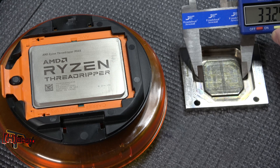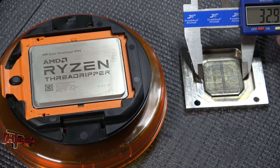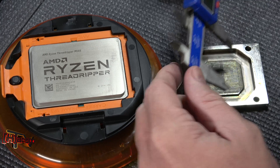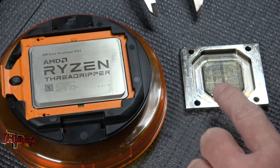The block surface is also right at 68 millimeters, so it will cover the CPU fully. But when you look at the actual fin pattern, we've only got about 33 millimeters across — let's round up. So the fin pattern is about 33 by 33 millimeters, which looks pretty much square.